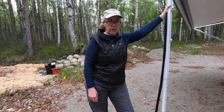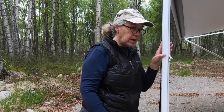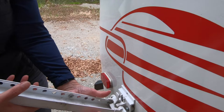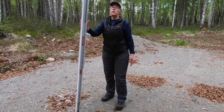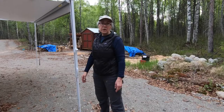What about the carport position? That's when the arm is no longer attached to the RV and is down on the ground. You can do just one arm down like this so you don't run into it, or you can bring down two. Grab a hold of the arm, push in and pull out, and now you're basically holding the entire awning. Make it perpendicular to the ground and then stake it out. This is not a position we use very often — the normal awning position works just fine for us.